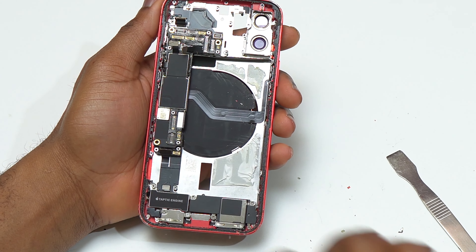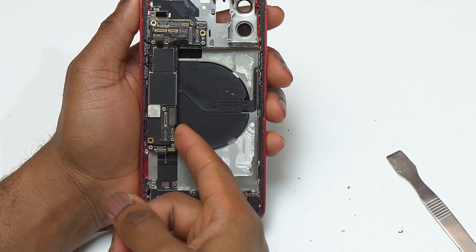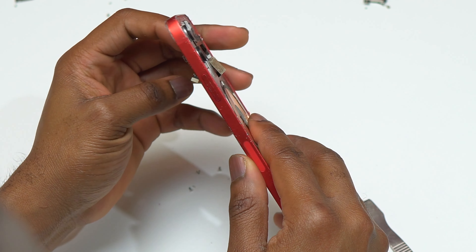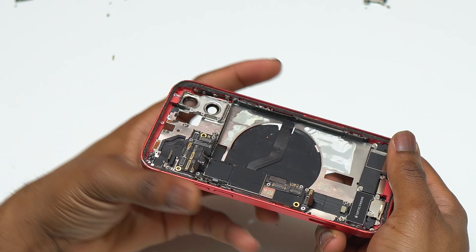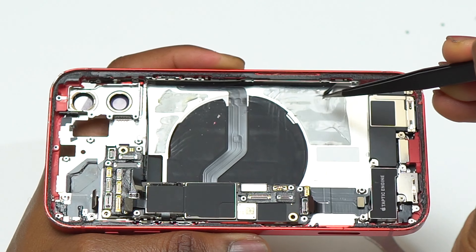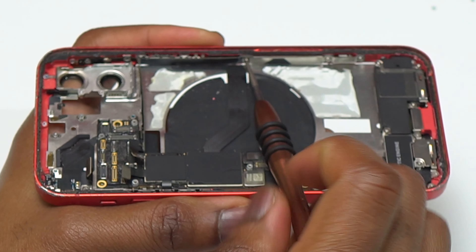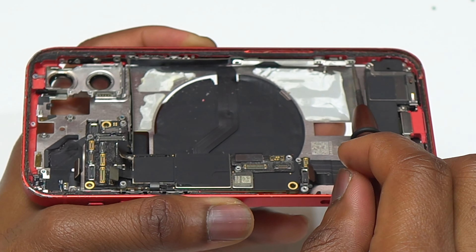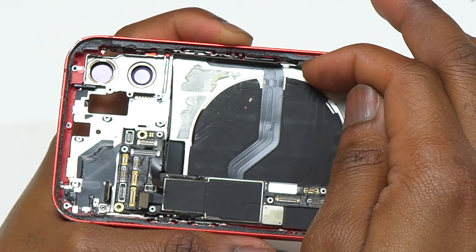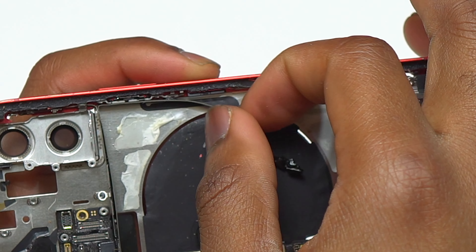After removing that missed screw, the SIM card tray came out. I then saw there was another flex cable below the SIM card tray that needed to be removed to access the motherboard. Also, I needed to remove screws at the right of the camera module — the whole right side of the device is attached to the motherboard and cannot be separated. If you damage that cable, you have no option but to replace your motherboard. This is what I call the ultimate anti-repair that Apple has created since the iPhone 12.